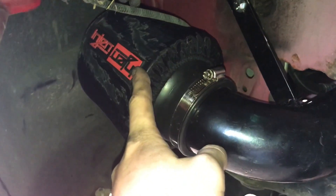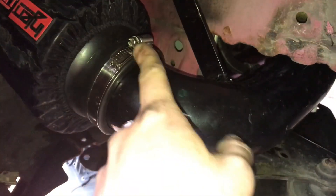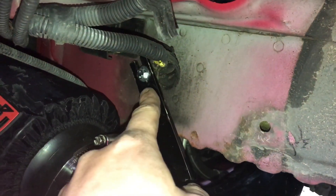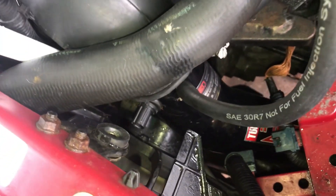When you're down in your wheel arch, you just want to slot your filter over. Mine came with a Hydra shield — lovely. Then just do the jubilee clip up. We've got the bracket all mounted and tightened up — solid, it's not going nowhere. We've got the rocker cover breather pipe on, in, and tightened. The vacuum line in and tightened, even though it's a bit big, but we won't cut it back. We've got all of the pipes down here tightened, and the filter on and tightened up. The bracket goes through that lovely hole there.